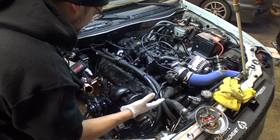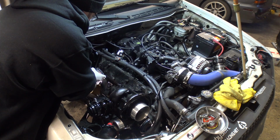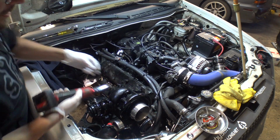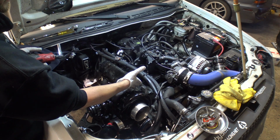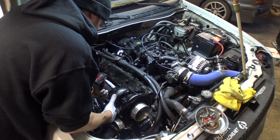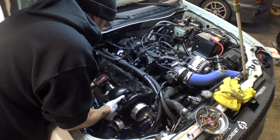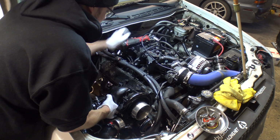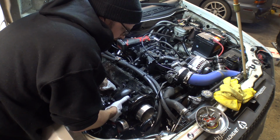Now there's more weight on the nose, so if you take the front out and you're trying to take the back out, you're trying to balance more load. So my only advice is leave the bolt, like the front one's hard to get to. So you leave this guy, you support your turbo with my little wastegate dump and everything. I've never tried to rip it out all in one piece since I changed everything. Get this guy out, don't let it wiggle so you don't butcher your threads. And then it's ready to rock, so let's see.